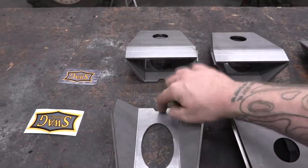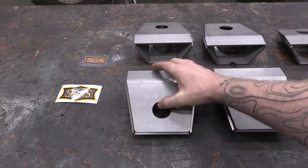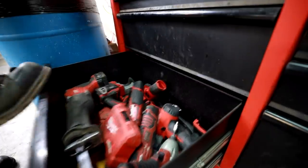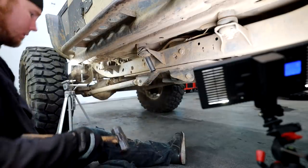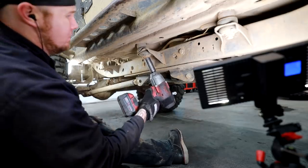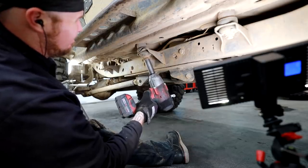I think that the weep holes are a really nice touch and a good indication that a lot of thought and development went into these body mounts. The majority of the weight of the Jeep is being suspended in the air by these center six body mounts, so I don't feel comfortable just cutting them all off and hoping the tub doesn't sag onto the frame. What I'm going to do is cut off the center body mount on each side first, weld in these new heavy-duty body mounts, and then proceed with the outside four.